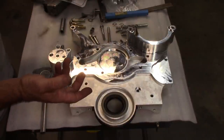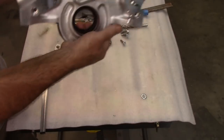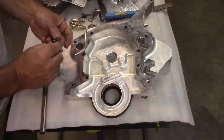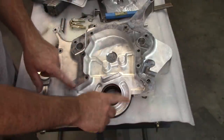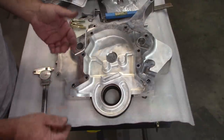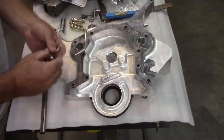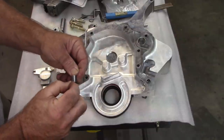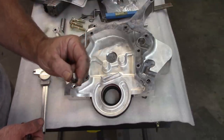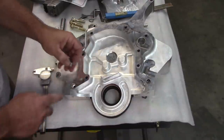The only other thing that I can see that may be an issue is these little guide pin bushings. I may have mentioned this earlier. They go on the backside. And these just drop into the recessed holes in this fixture. But there's enough shoulder there that it will align with the recessed holes in the block. Whether that's a good thing or not, I don't know, but it's all I really have to go by. That's how it's made. Now I could expand these out a little bit and force them into this opening, but what I found is, as they are right now, they fit snug into the block. So it would become a conflict to make them big enough to fit this. I don't know why there's two different dimensions.